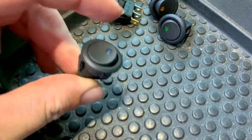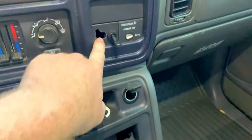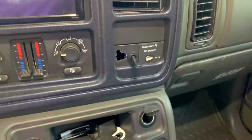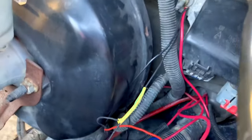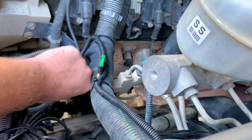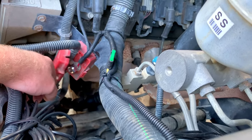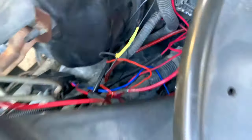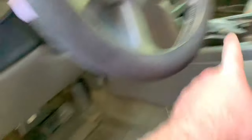I'm going to show you underneath the hood where I have the power wire ran to the battery because this is my rock light switch. I used to have my e-fans right here, and when the e-fans were here the rock light switch was there. And how it got so big is I had wire ground out because I ran the wires poorly before — the switch melted to the dash and almost caused my truck to burn down. But I have the positive wire coming straight from the battery ran right here. The wire comes inside, connects to the bolt in here. I put an extra threaded nut on there — I actually found this in my spare nuts and bolts. Ran that wire to it — comes up here, about a 30 amp inline fuse — runs all the way up, runs across here, runs through this little mess of wires, and runs into the firewall. Then goes from the firewall down here, across my dash, and up over to there.